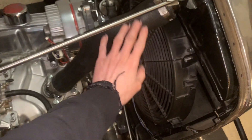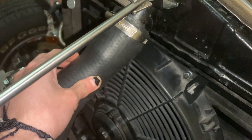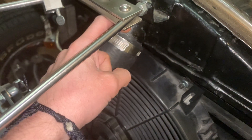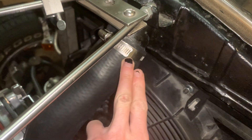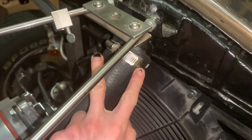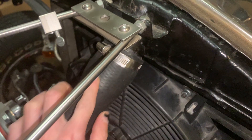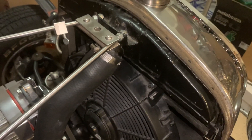The radiator here — this part where the hose goes in — around this area is really bent. I don't know if they used screwdrivers to try to pry the hose off in the past, but they created dents all around here. So I had to use a little bit of silicone to make sure it sealed as good as it could. I moved the clamp and the hose as high up as I could because when I filled it up to the top, it began leaking antifreeze.